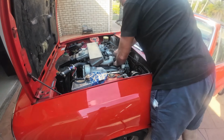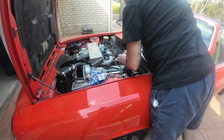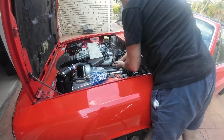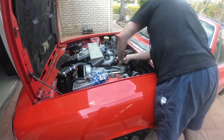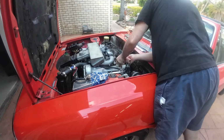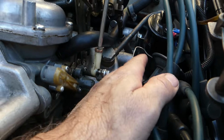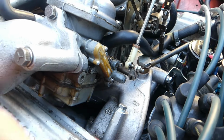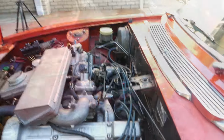First up is the advanced retard pipe. This runs from the distributor across to the left-hand bank carb. I'm going to remove the piece of pipe that's in place and fit the Rimmer Brothers correct part. It's got elbows and a piece of pipe. I get all my parts from my trusted Stag parts supplier, that's Leon. So let's hook in and get this bit underway. Bit fiddly, but we'll get there. That's the advanced retard pipe fitted in. You can just about see the elbow on the distributor there where my finger is. The one under the carb was tricky, but not as hard as fitting the pipe.